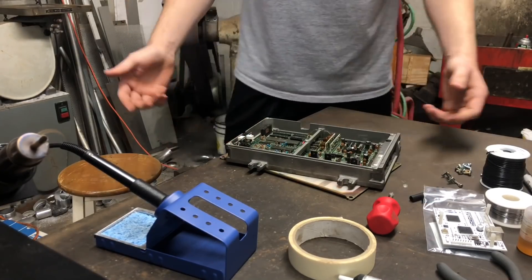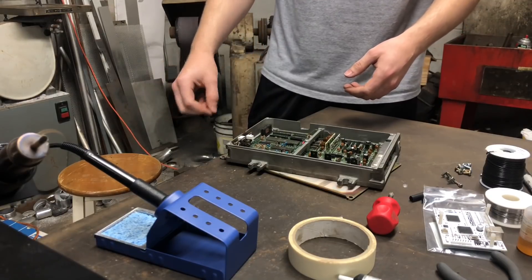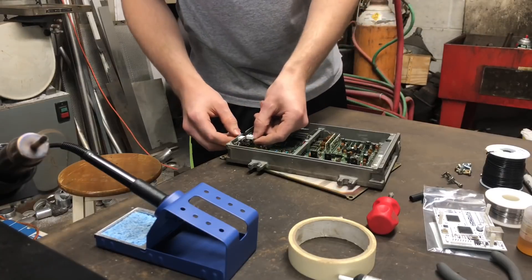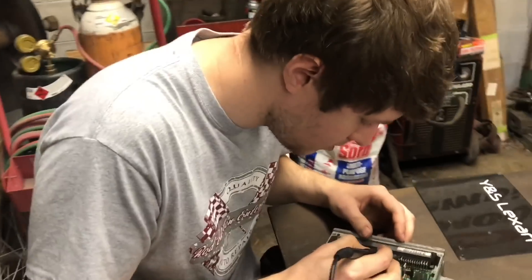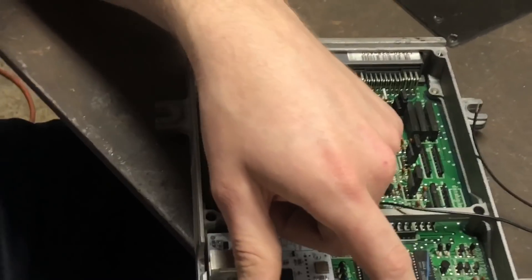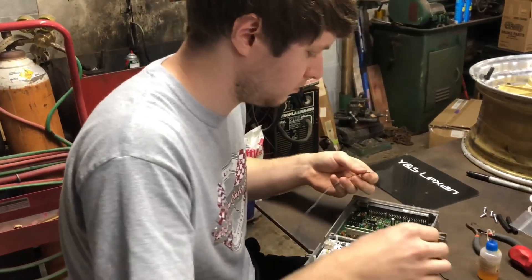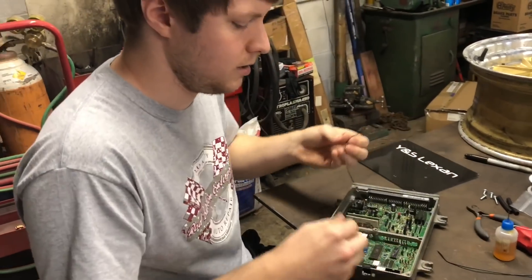We also supply all the components for coil connectors — we supply these connectors, which typically if you buy from another dealer you just get a pigtail and have to solder your wires. I personally don't like that, so we have these connectors with all the crimp pins and everything for a one-piece connection. For a motorsports component, that's definitely the way to go. Right now we're soldering two leads onto these pins: one is a 12-volt power lead, and one is the CYP sensor lead — the cam position sensor — which is what this uses for its firing signal coming from the distributor. That's the signal at the bottom of the distributor that tells you your cam position, and it basically makes the ICM igniter not needed once it's connected to this chip.